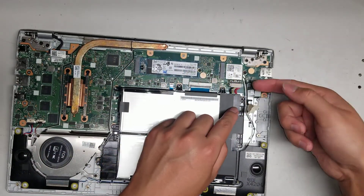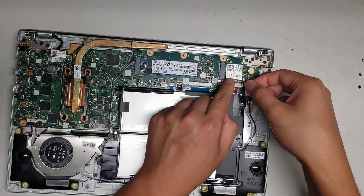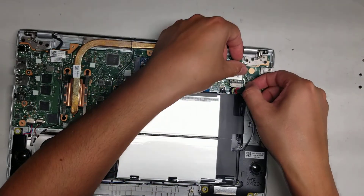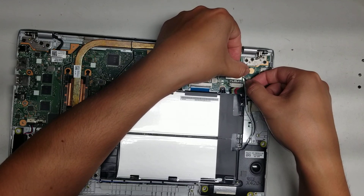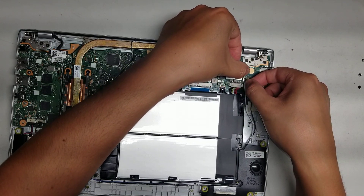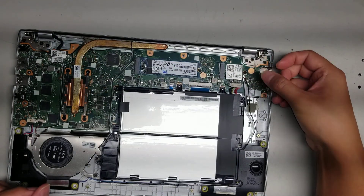The wireless antenna is just like every other model — you just pull from the tail up and it'll pop out like that. To put it back, you just line it back up to make sure it's aligned. I use my fingernail on top and I try to see if it'll move around — if moving my fingernail on top of it doesn't move it around, then it's good, and I pop it down.